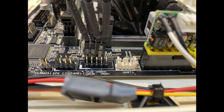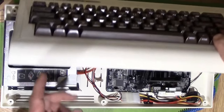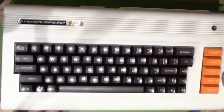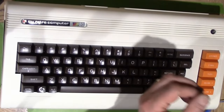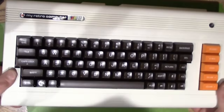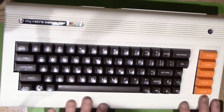Both wires are now plugged in. Make sure all wires are out of the way of everything, then slowly close the top half of the case down. Once we're finished working inside the case, disconnect the crocodile clamp and remove the ESD wrist strap. Maneuver the case closed — everything is installed inside. All that's left is to screw it up and boot it.